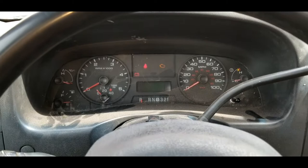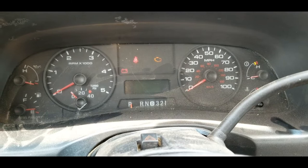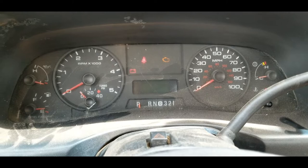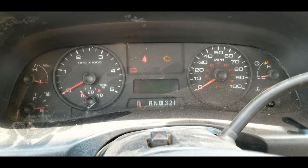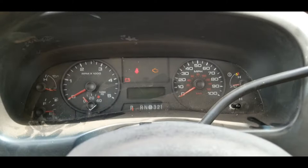Today I'm working on a 2005 Ford Super Duty diesel. This one has the typical gauge cluster issues — the odometer display doesn't work, one or two of the gauges are sticky, and we see these all the time with various issues. They could also have false malfunction indicators on or blinking, could also cause the radio to shut off and the power windows to lose power. Lots of circuits go through this cluster, so when it fails, lots of things can go wrong.